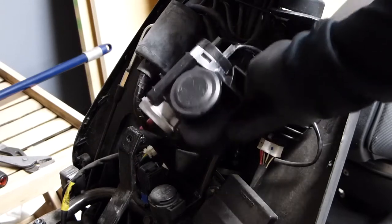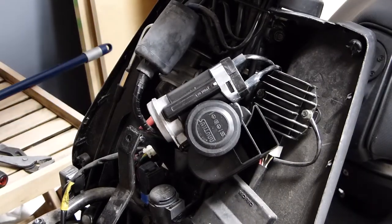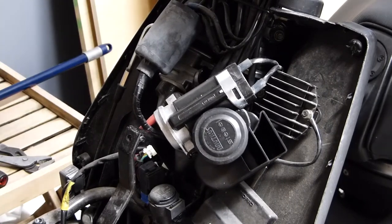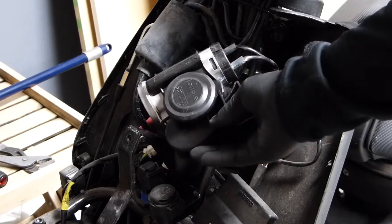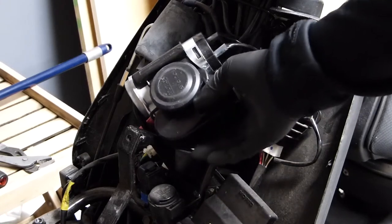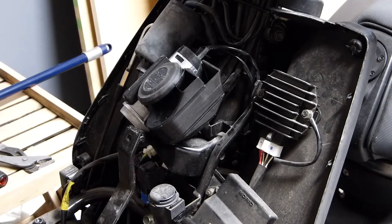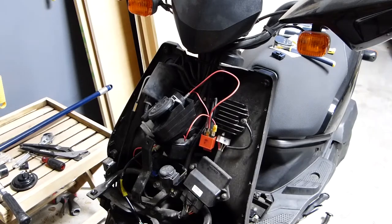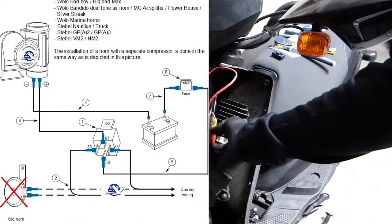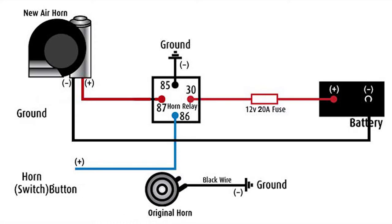Now that it's hooked up to the mount, you can see we've just turned it sideways and it can sit on that. You can basically just plug in the existing wires from the original horn and it works. But to be safe I'm going to run a relay switch — you could leave it like this and maybe it'll work, but I don't know if it's going to blow a fuse or what the ramifications might be. So to take that extra step of caution, we're running a wire from the battery all the way up here. Now that everything's connected, we'll put a wiring diagram link in the description, but here's the negative, here's the positive. Before we seal everything back up, we'll do one final test.